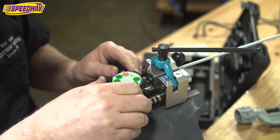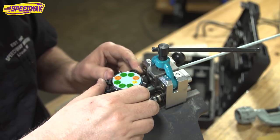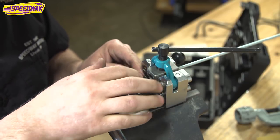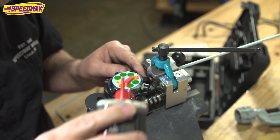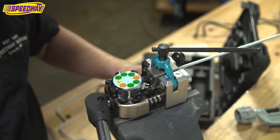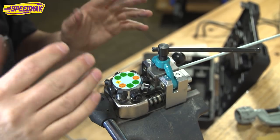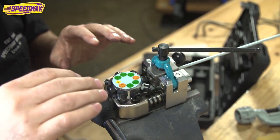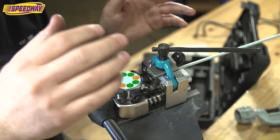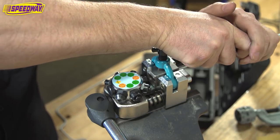Second, that creates the bubble. You go to operation two on 3/16, which is an orange guy over here. And again, a little bit of oil never hurts, just kind of keeps things nice. And we'll crank it down again. And you feel it, it's so nice. This handle, you can feel how the pressure is affecting the tool and affecting the tube. And you know as soon as you have that nice flare on the tubing, it's a done deal.